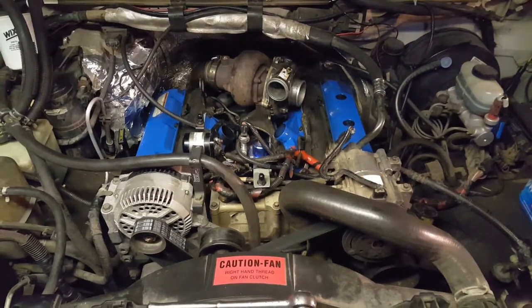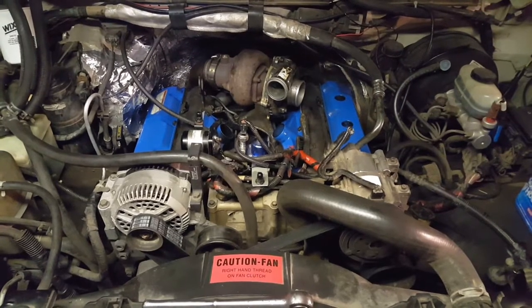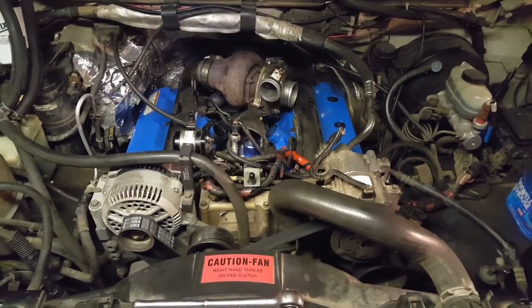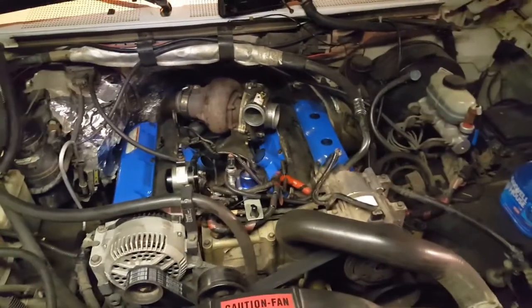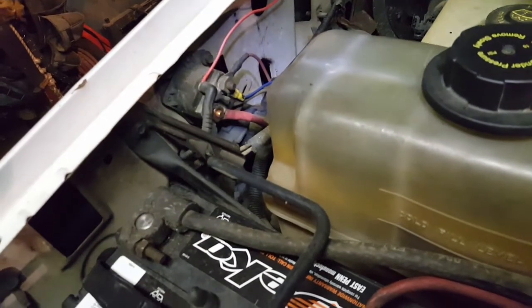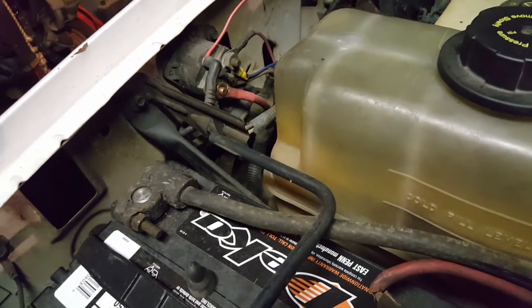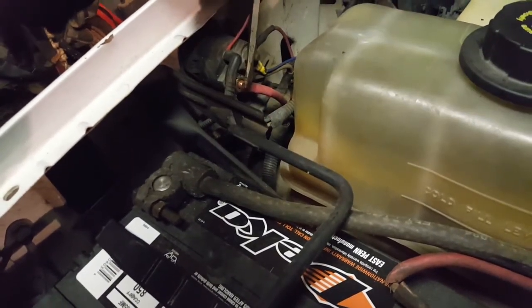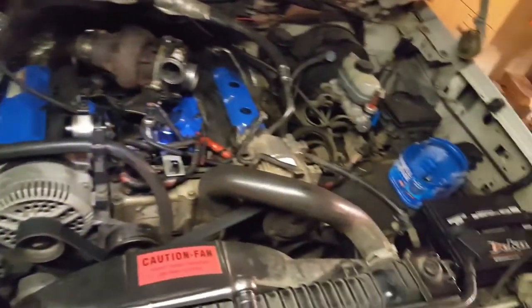The best way to do this is from under the hood. This is a five-speed truck, so before you do this: make sure your emergency brake is set and the truck is in neutral. We're going to bypass all the safeties to engage the starter. If the truck is in gear with the clutch out, it's still going to crank and it'll move. So make sure it's in neutral. What we're going to do is use a screwdriver to bridge the two large terminals on the starter relay — that bypasses all of the ignition. That allows us to crank the engine over without firing the injectors or starting the electric fuel pump, just to blow all that oil out.